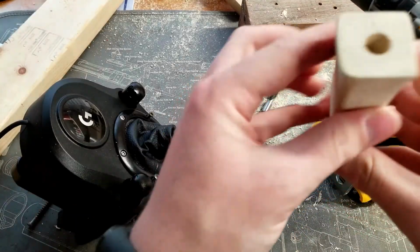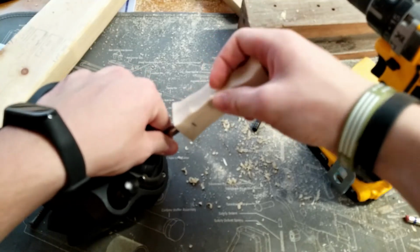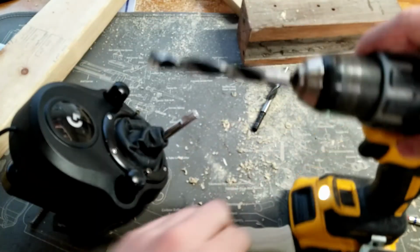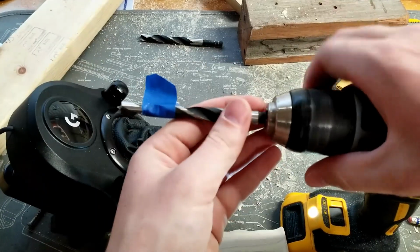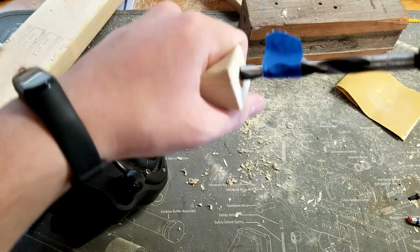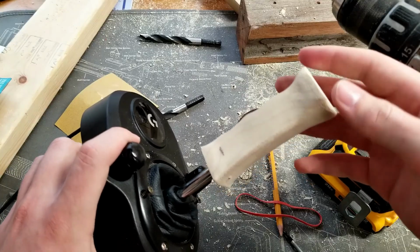It was still a little loose, so I tried to figure out how I could keep it in there. I decided to use the factory screw that came with the first stock knob and drill the hole in the front of the new shifter knob so that I could tighten it down on that flat spot. I seem to have lost the footage from this, so you'll just see the end result, but all I did was take a countersink bit and drill it all the way through.